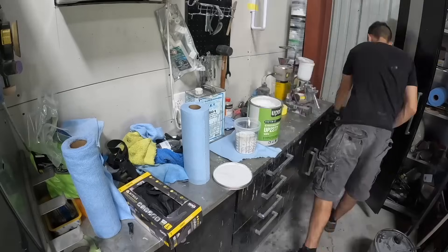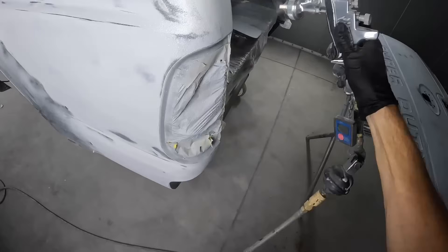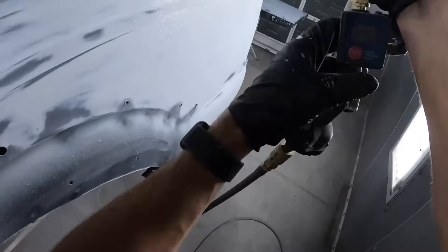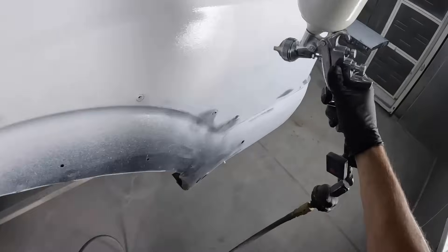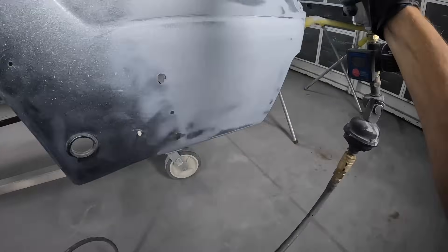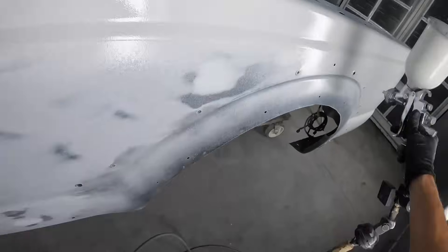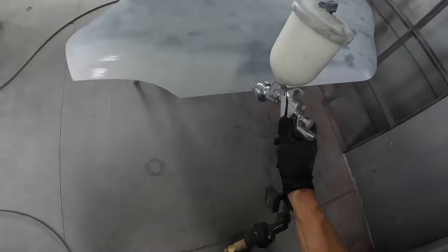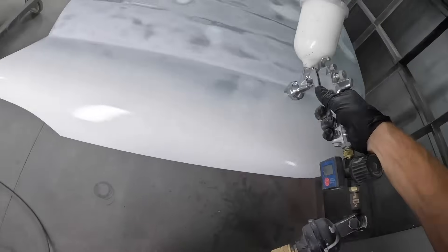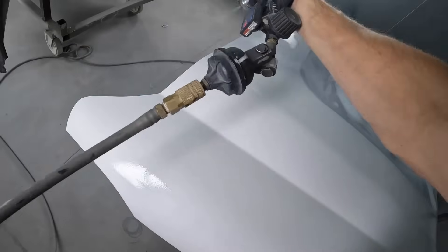Hood is almost ready for primer. We're using two different types of primer. This right now is a direct to metal since we went down to bare metal in a couple of spots. It's similar to an epoxy, but it still has a high build and sandable characteristics. I use this primer on a lot of stuff. We're just laying down a nice thick coat so that if there are any waves or wiggles, we could go back through. Josh did a little bit of body filler on some of the low spots. After this primer, we should really only need to wet sand it with 400 grit and it should be almost ready to paint.